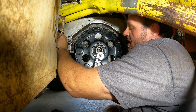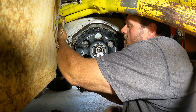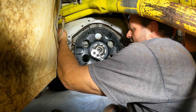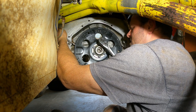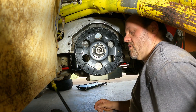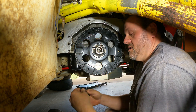Let's see if I can get a lock on it. Yeah, that should work right there. These are ARP flywheel bolts. I think these torque to 75 foot-pounds — the stock ones are 60 foot-pounds, and I think these are 75. But I'll check. And this is the coupler I have for this Falcon transmission right here.